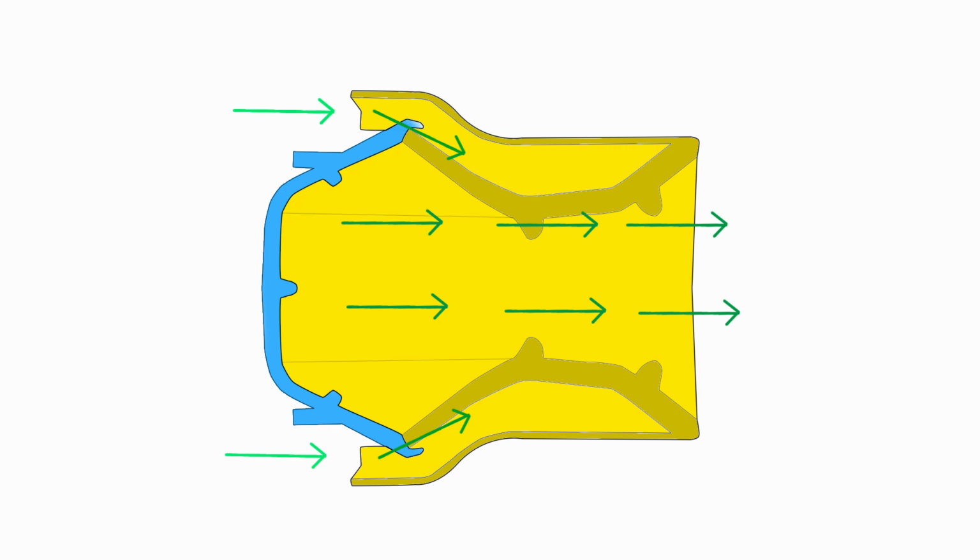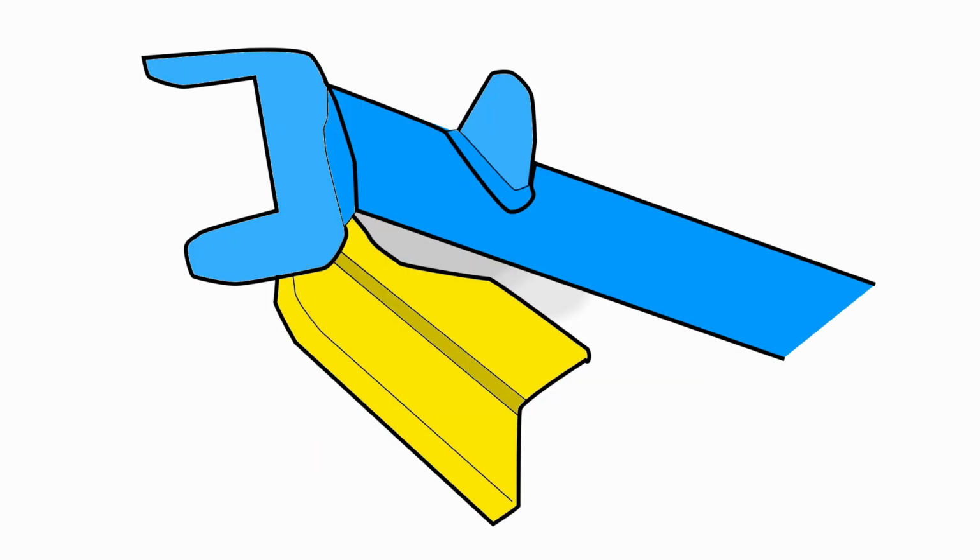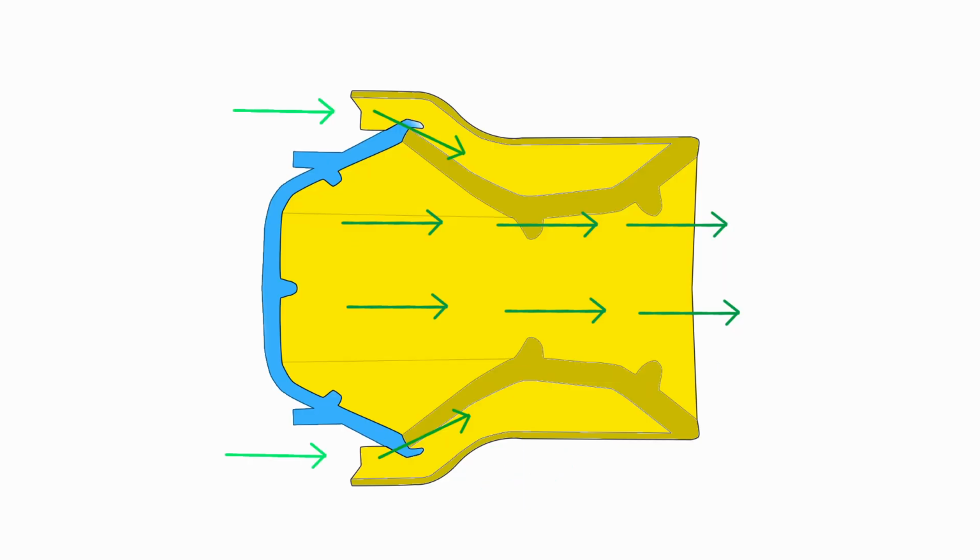Motorsport UK's regulations are a little bit stricter because they in addition say the floor tray must be flat with any deviation allowed upwards and not downwards. So there's less ambiguity there compared to the FIA's regulation. But let's have a look at what they're trying to do. These two ducts at the edge of the floor tray, if you look at this sort of hastily put together illustration, it seems to want to drive some more air underneath the kart, and the floor tray is wider and it's sculpted around the frame. So they're just trying to create a larger area underneath the kart that's flat.